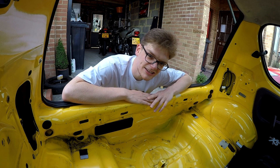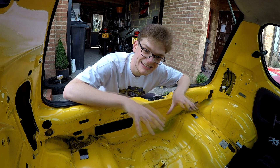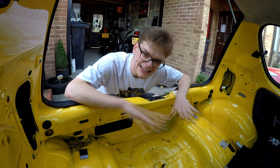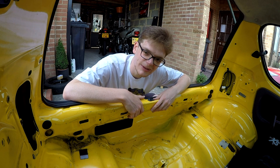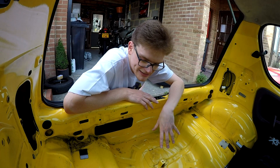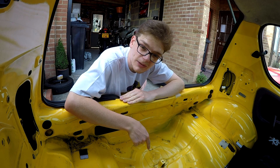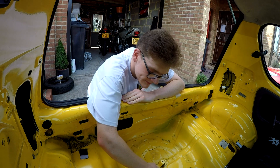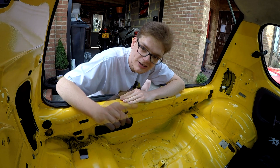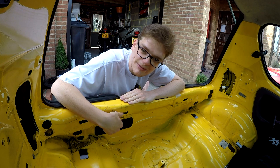As I said in the original sound deadening episode, the first thing you need to do if you're going to be sticking sound deadening on is make sure your surface is clean, because if it's not — much like anything sticky — it's not going to stick very well. Right, so we've cleaned this place out, and for reference before we start the sound deadening, this is what the spare wheel well sounds like without any sound deadening in it. And this is what one of the rear arches sounds like without any deadening in it. Let's see how much of that improves.